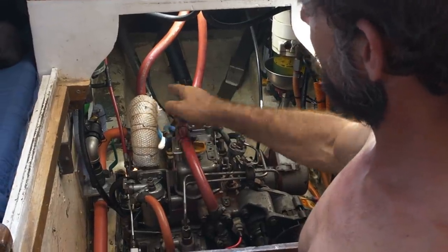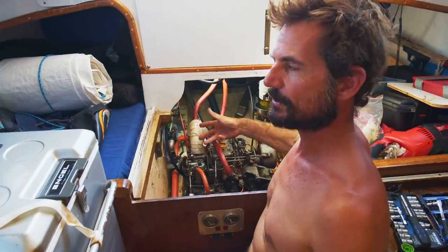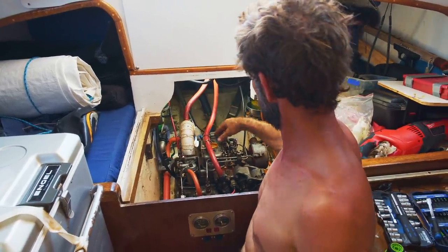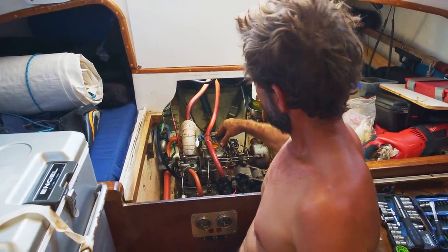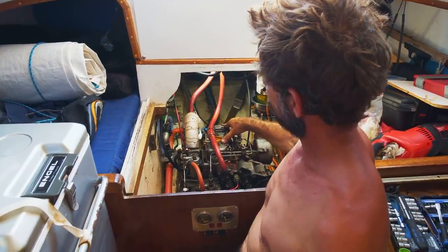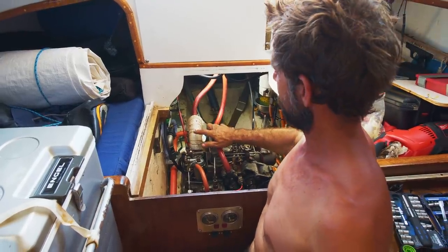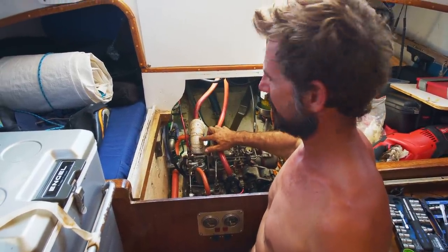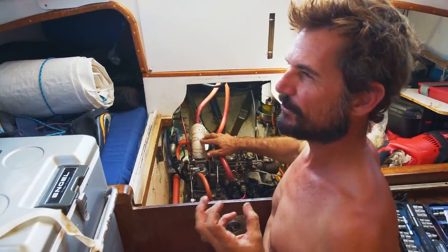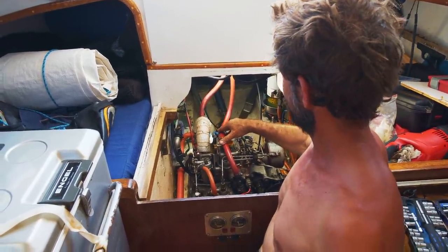This is our new exhaust that we've just placed in, just lagged there — it prevents any burns but just keeps the temperature in the pipe and on its way. Everything's lagged up. For people that don't know what lagging is, it's really itchy tape made of fiberglass that you put around exhaust. You can seal it with water-based house paint and then enjoy the smell as it burns off and sets the fiberglass, but we haven't done that. Very neat install.